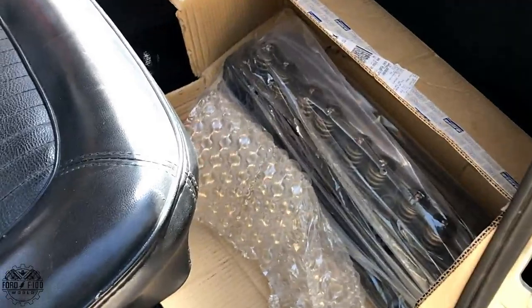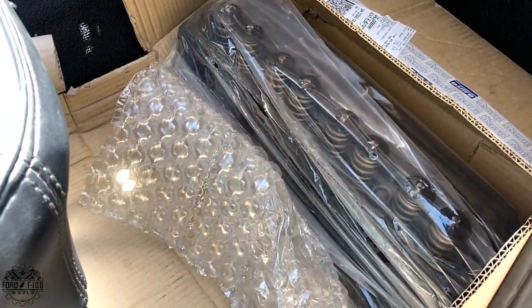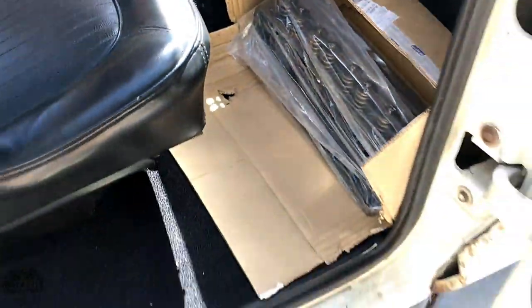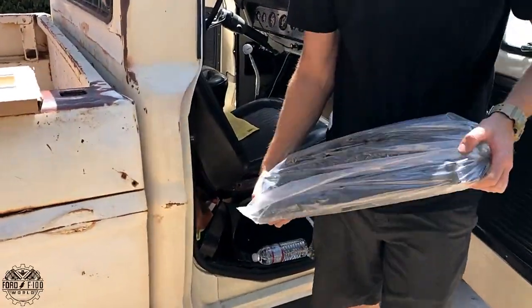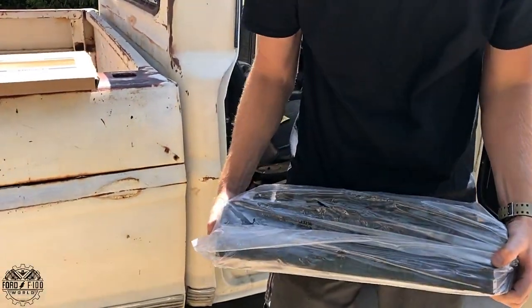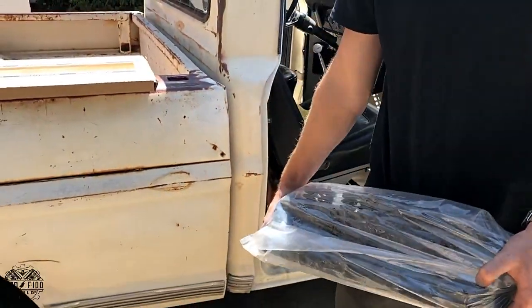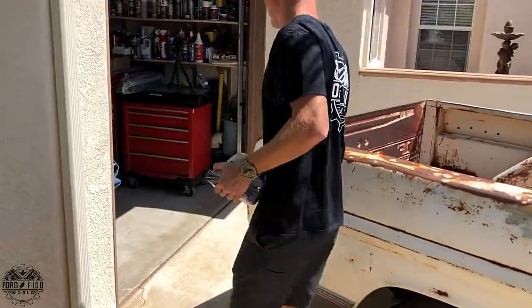It's got new valves seated to it. Resurfaced old ones, you got springs. Set up for 500 plus lift. Yeah, it'll take a lot. It's a brand new decked 60cc GT40P, brand new exhaust valves, brand new double valve springs. Done right at a local machine shop. You get the full service. This is everything. Salon service for this.